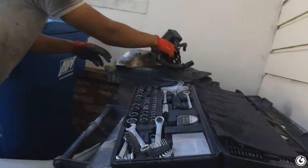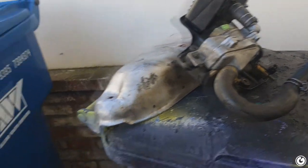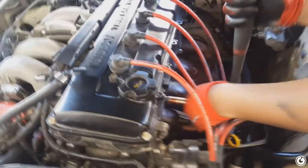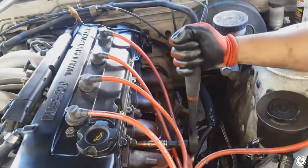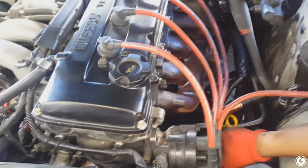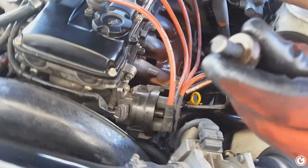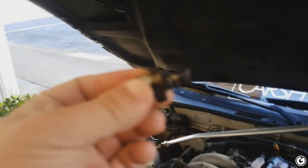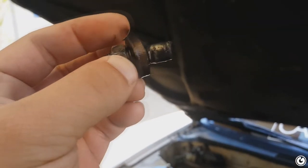So Jer thinks the Japanese engineers at Nissan wasted their time developing that IAV. His theory: they over-hired engineers during the Japanese bubble and said 'figure out something for the 240.' Why are these bolts so loose? Exhaust bolts are probably the worst bolts you will ever deal with — the studs come out, you'll strip them. These are pretty loose. Oh shit — that's broken, it snapped. That's probably why I had the leak, look at that. That's a snapped exhaust stud — you can see the thread on the other side.